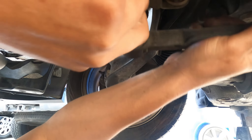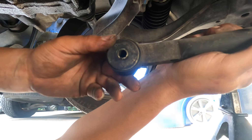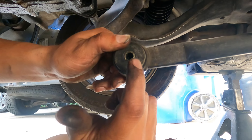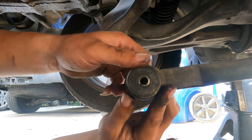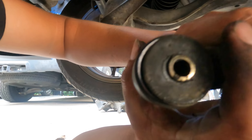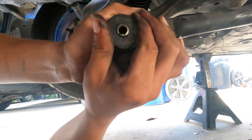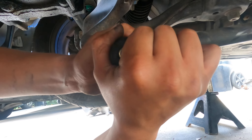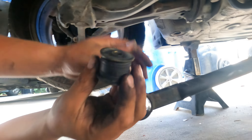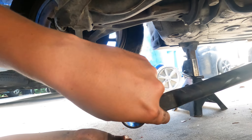Everything's in the way, right? There you go. So we're going to be removing this bushing. Damn, that's already had a lot of play. I'm going to try to remove this pin out first, and then the bushing. Yours came out real quick — pretty easy. This one has 220,000 miles; this bushing is pretty busted compared to mine.